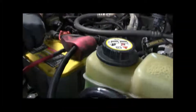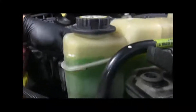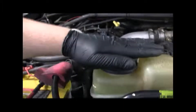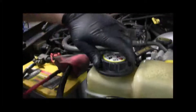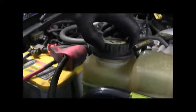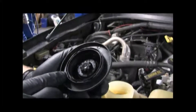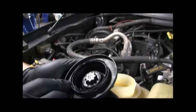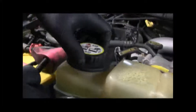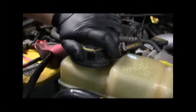You can check your coolant level really easily right here. I like to shake it just to make sure that's actually the coolant level and not just a stain on the inside of the container. Now, this engine is cold — you don't want to remove this cap when it's hot. We'll go ahead and take the cap off and look at the inside seal on this radiator cap to make sure it's still good. It looks good, there are no tears or cracks. The color of the coolant looks good as well.